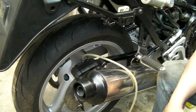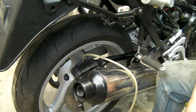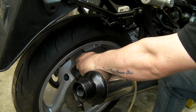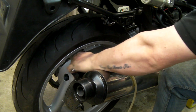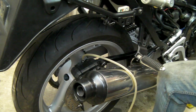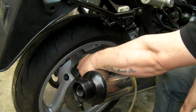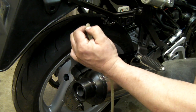These pads still have a fair amount of life — I believe it was about halfway, a little bit under, so I'll set it to about a third of the way so I know when it drops that I need to change the pads. That applies to front and rear. With each pedal press it does take the fluid level down quite a bit. There's a little window on the side of mine so you can see it; this one sits under the seat but it has a window.